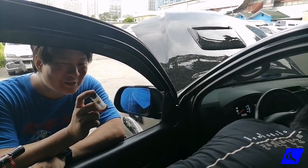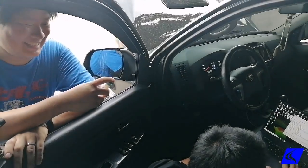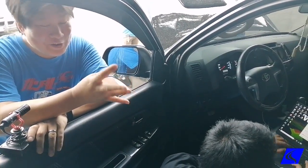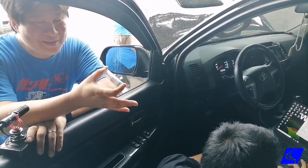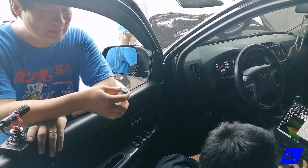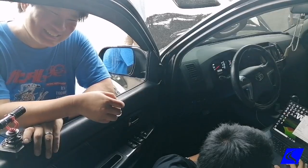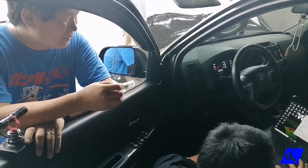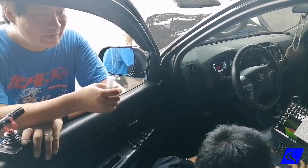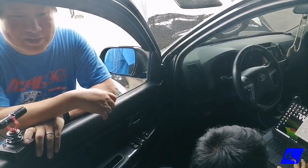Oh, by the way, our injector nozzles were supplied by BP Remap. That's this guy over here. So I will get him to tune because it's his product. We already did the initial tune of this one, but when I talked to the owner again and told him the results, he said, "Oh, what can be done to make more power?" So Edward here from BP Remap suggested, "Oh, let's do an injector nozzle upgrade, which is these things." So he supplied it. He's going to tune it. So we'll see how much more power we get. What we're going to be doing now is we're going to put it back to stock first, see what the baseline is here on the roller dyno, then we'll tune it, then we'll put alcohol injection on it, so should be interesting.